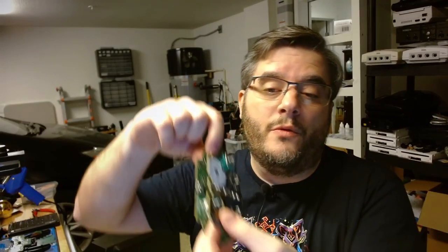This capacitor is a decoupling capacitor, which means that its primary function is more or less to reduce the noise on the signal line. And it's found behind the CPU through a via on the back. So it's attached to a CPU pin to reduce noise on the CPU's signal pin. It probably will work without it. I don't really know what that pin even is doing or what the effect will be, but since it's mine, I'll take the risk. So all I can do is put it back together and then test it and go from there, I suppose.